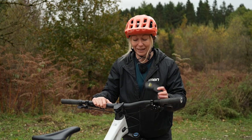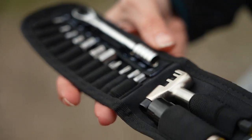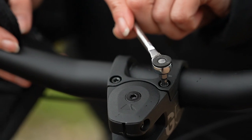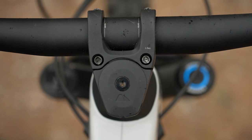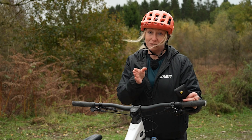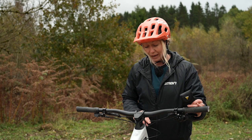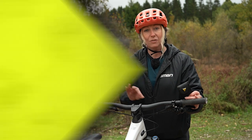With a new bike, it's really handy to take a Torx wrench or a multi-tool out with you, because there'll almost certainly be something that's not quite perfect when you first start riding it. What's always common is not quite getting your handlebars lined up with the front wheel. My big trick here is to line up the handlebars with the stanchions of your fork. I see so many people using the stem on the tire, and if the tire's out of line, or if your stem's really short, or you've got a lot of cables in the way, that won't be quite perfect. So use your handlebars on the tops of the stanchions of the forks.